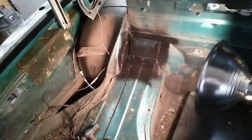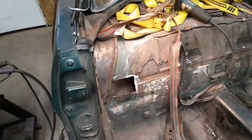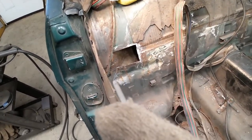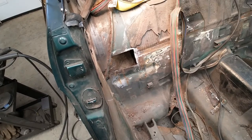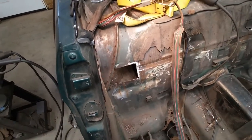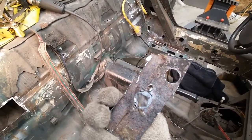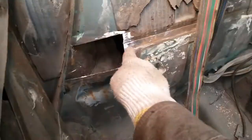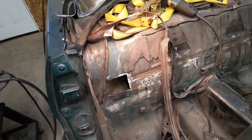Anyway, I can carry on now onto the next project. Here's where I just finished fixing up - over there where all that corrosion was, and then over here is the same place but not as badly damaged. So I just cut out that little bit there. First I tried to just drill a couple of holes and put a plug in but that failed - it was too weak at the back here to be able to weld on it. So I'll cut a piece and put it in there. It's got this kind of seam in here where the two body bits mate and I'll see if I can replicate that pretty close.